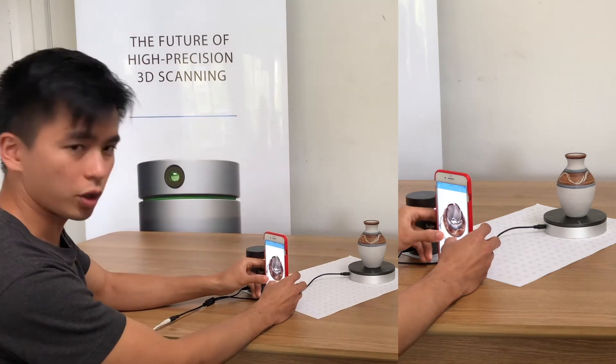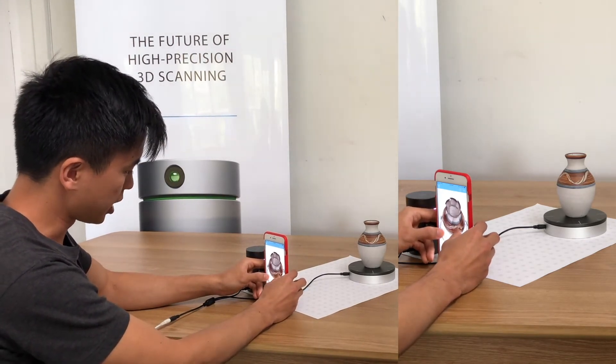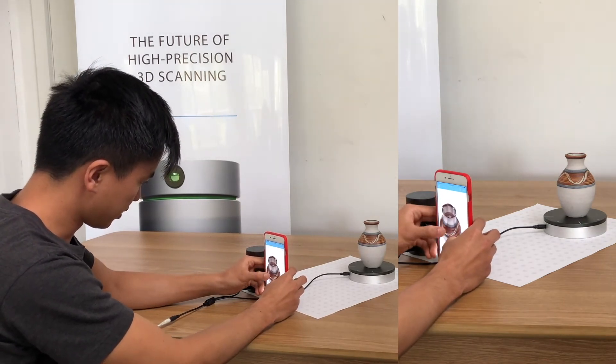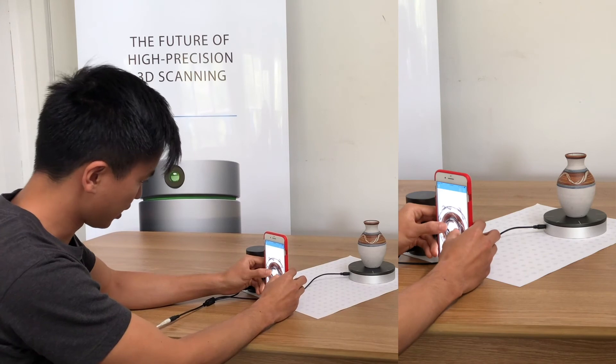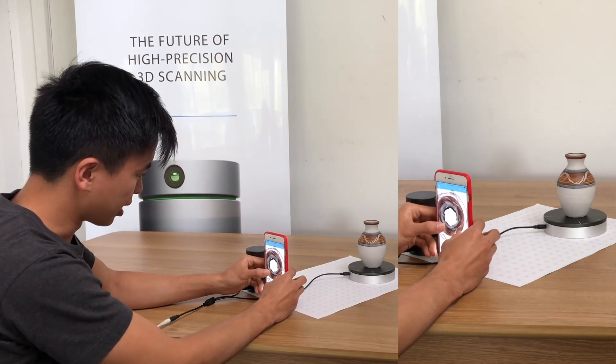So this here is what we call a tornado effect, and this tells us that the turntable has been misaligned. It is most obvious when you look at it from the top view, and you can see each side is at an angle.